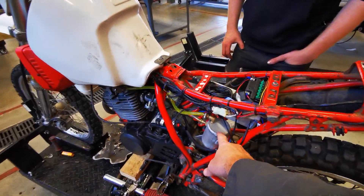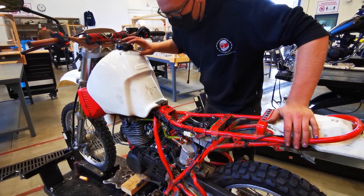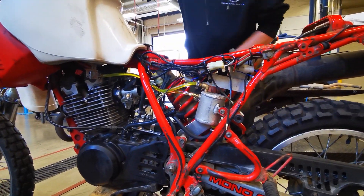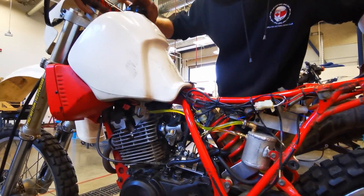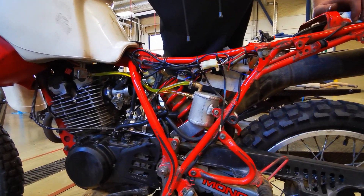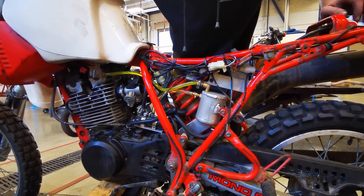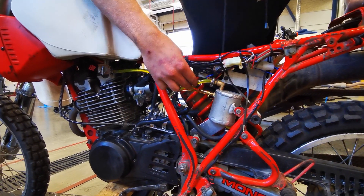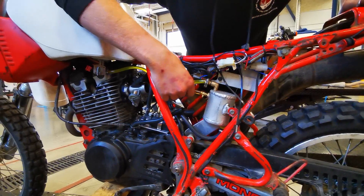And what is this thing we had to build? We had to build a swirl pot because the fuel pump has a return line, and we didn't much feel like tapping into a plastic gas tank to do so. The swirl pot usually helps get the air out of the fuel as well. So this is full of fuel right now — there's a couple of air bubbles in here, still working them out.